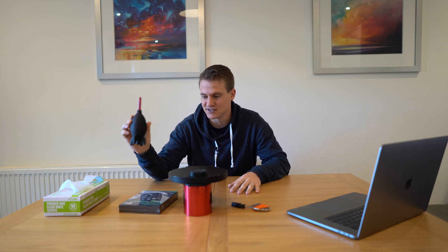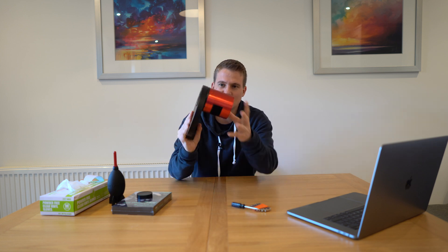I think I've got everything I need to get started. I have the tools to take the camera apart, a rocket blower to get rid of any dust or particles on the sensor and around the camera, powderless gloves to make sure I don't touch anything and leave oily marks, and I have a sensor cleaning kit. This is a generic APS-C size sensor cleaning kit — I think it cost £9.99 from Amazon and it's got good reviews so hopefully it does the job. This will also give me a chance to take the filters out of the filter wheel and actually give them a clean, since I haven't done that in about six or seven months. The filter wheel is bolted onto the camera so it's not that easy to open up and clean the filters, so this is the ideal opportunity to do that.